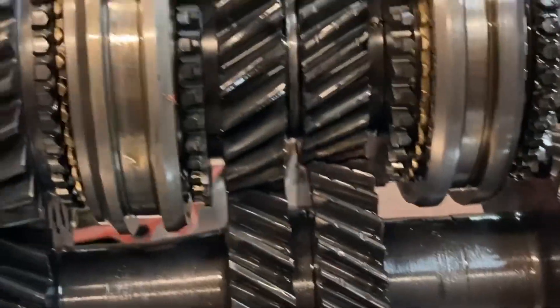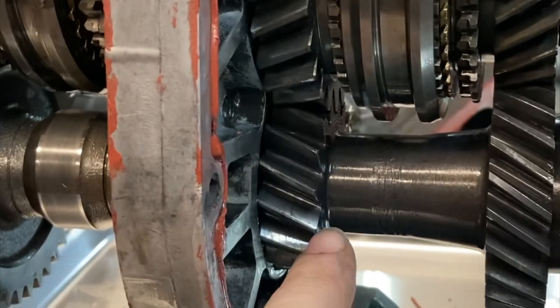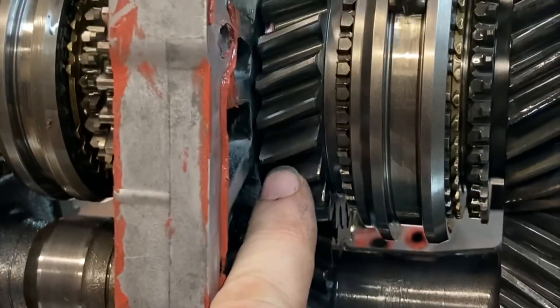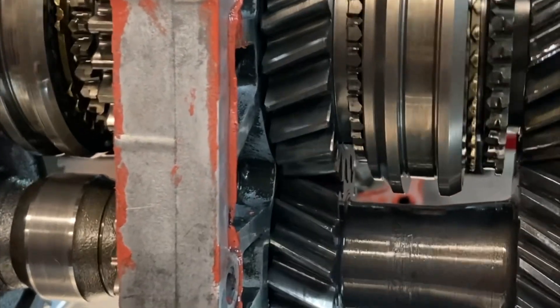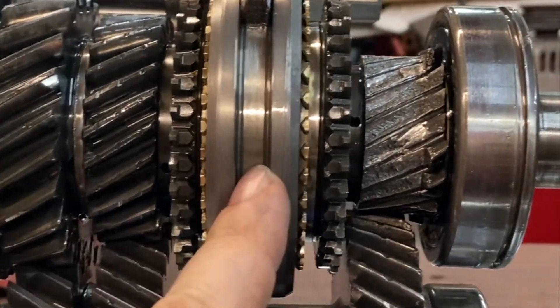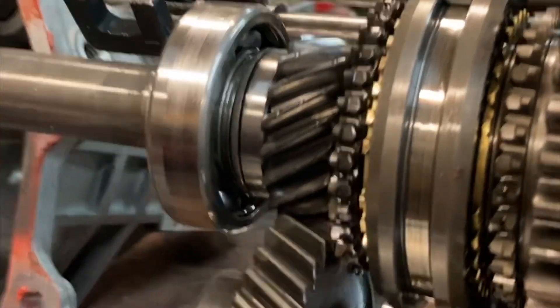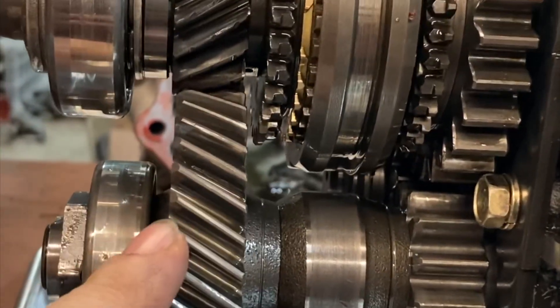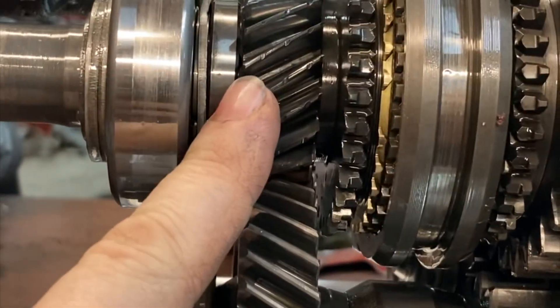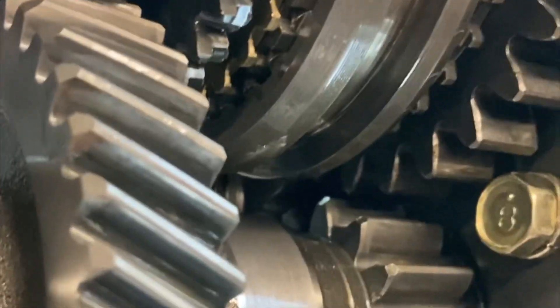These gear sets are on bearings and can freewheel. They all turn together and they freewheel on the main shaft. For the gear ratios, the cross shaft's smallest gear driving the biggest gear on the output is first gear — that's where it has the most gear ratio leverage. On the same selector as first gear is second gear. Third gear is the next one, and your fourth gear is a one-to-one drive that connects the input shaft right to the output shaft. Fifth gear is the biggest gear on the cross shaft driving the smallest gear on the output shaft. Reverse uses straight cut gears with a third intermediate gear that goes between them to reverse the direction of the output shaft.